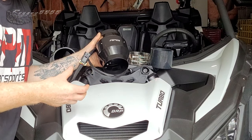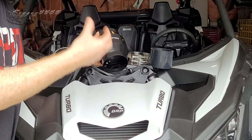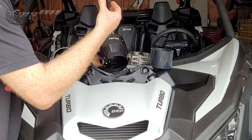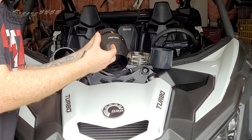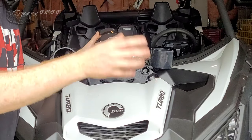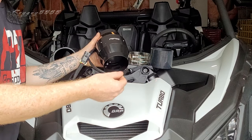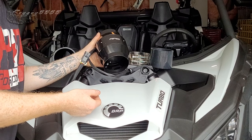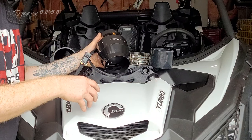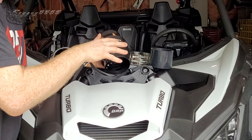When you go those types of speeds and have higher engine temps, the heat can't dissipate out of your clutches the way it should. Even though your clutch has from factory some sort of cooling fins or device to keep airflow moving, when your clutches aren't spinning that fast and you're generating heat from slow speed riding, you're just continuously building up heat inside that clutch box. I don't have a clutch temperature gauge.